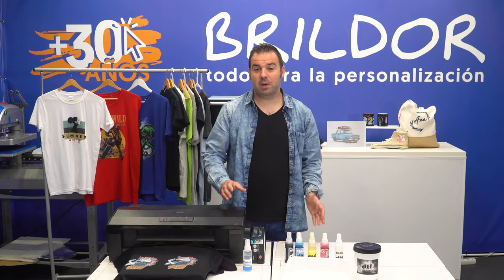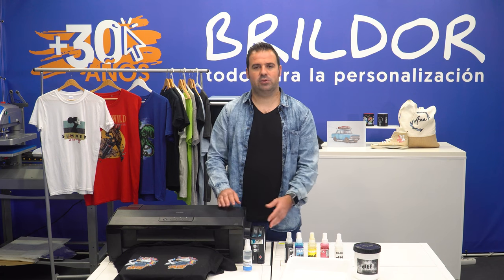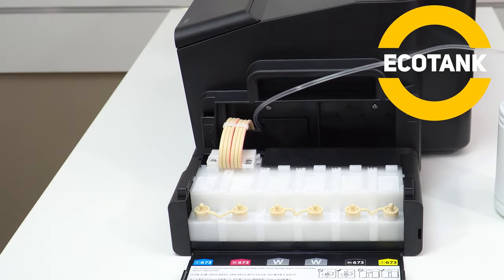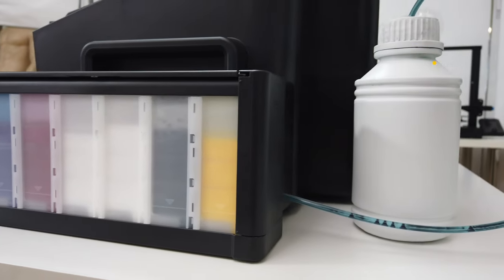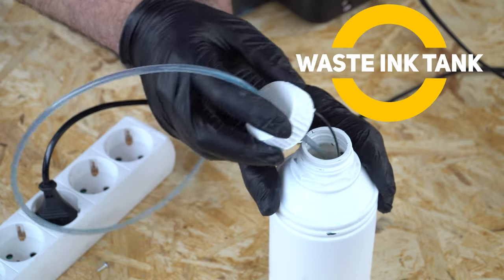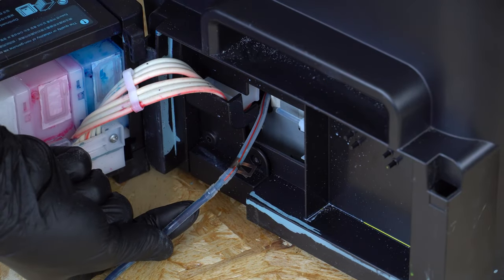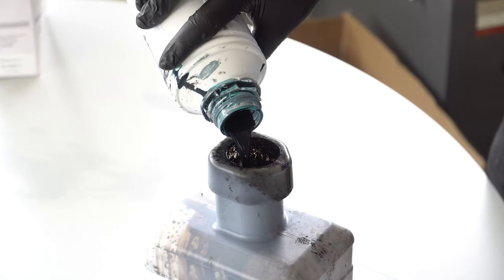Before we get to the problems, let's see some parts of the printer you should know about, as we will mention them during the video. First, we have the EcoTank — the container where the ink tanks are located. It should be filled up to at least one third full of ink to avoid problems. The Waste Ink Tank: to prevent the waste pad from filling up, printers are modified with a waste ink tank. It must be emptied regularly or it may cause a breakdown.